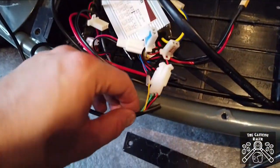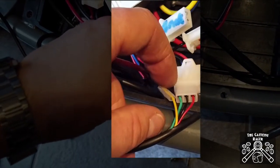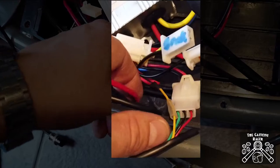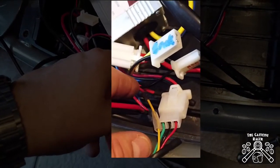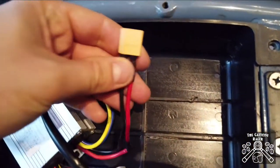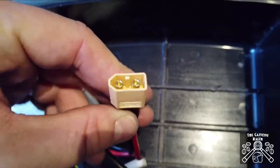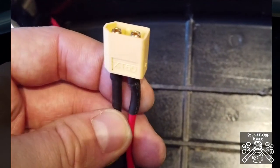On the throttle you've got three wires for your controller throttle, and then there's a yellow one — I've just connected that to the spare live that I had, and that gives me my voltage reading on top of the handlebars. For the power connection I'm using XT60s, which are a bit of a pain to solder but once you get the hang of it they're really good.